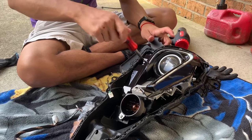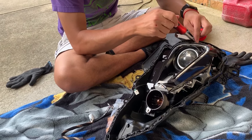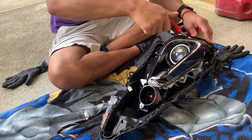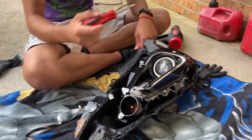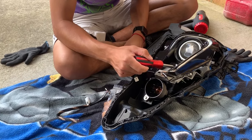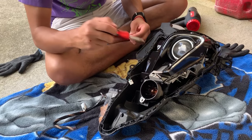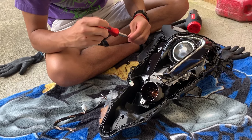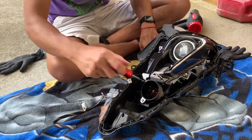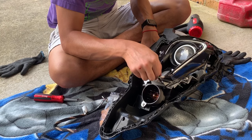If you are painting this, I recommend you get some kind of paint that's high heat, because these HID lights that are in there from the factory get pretty hot. You don't want your paint to melt inside there — that would not be a very happy ending for you. Once you get these screws in here, you don't want to over-tighten these either, because you can snap the plastic. And don't forget to plug this back in — your turn signals.